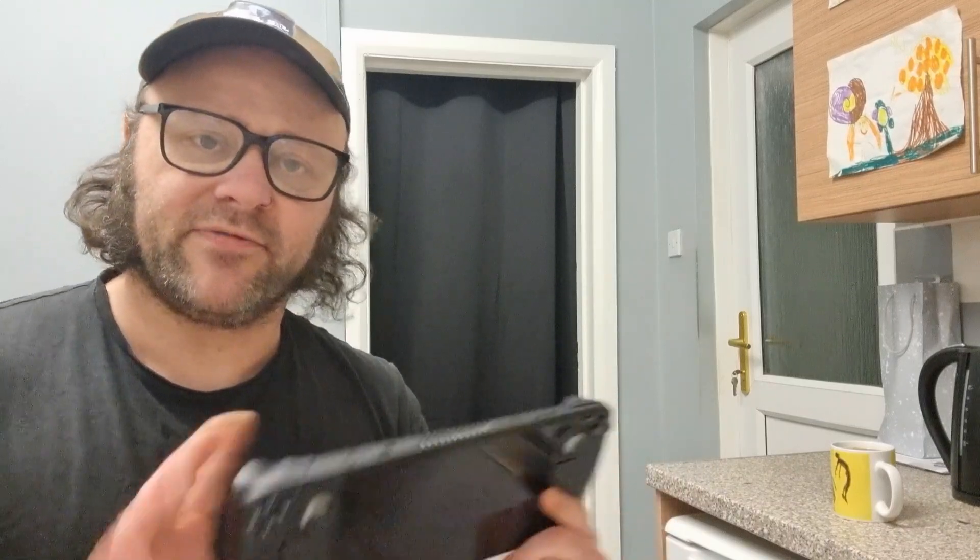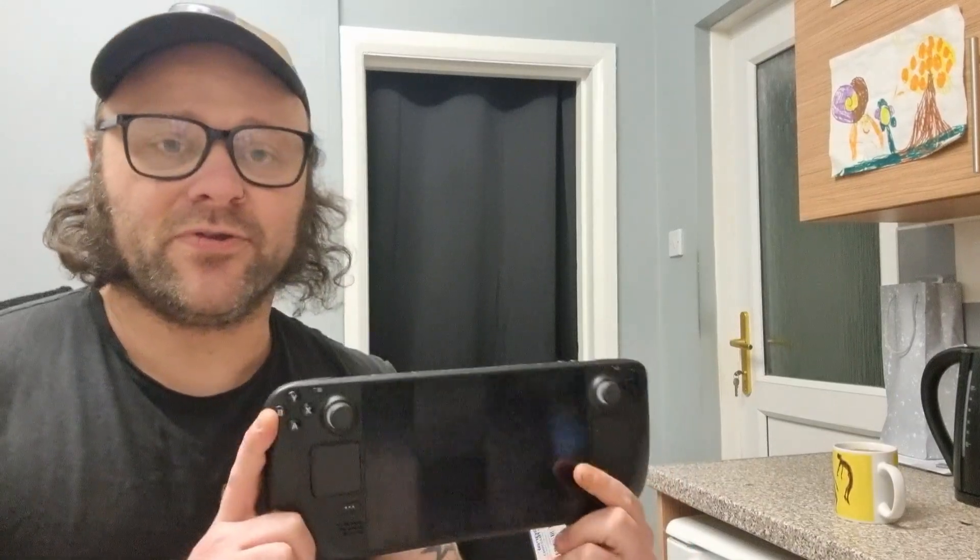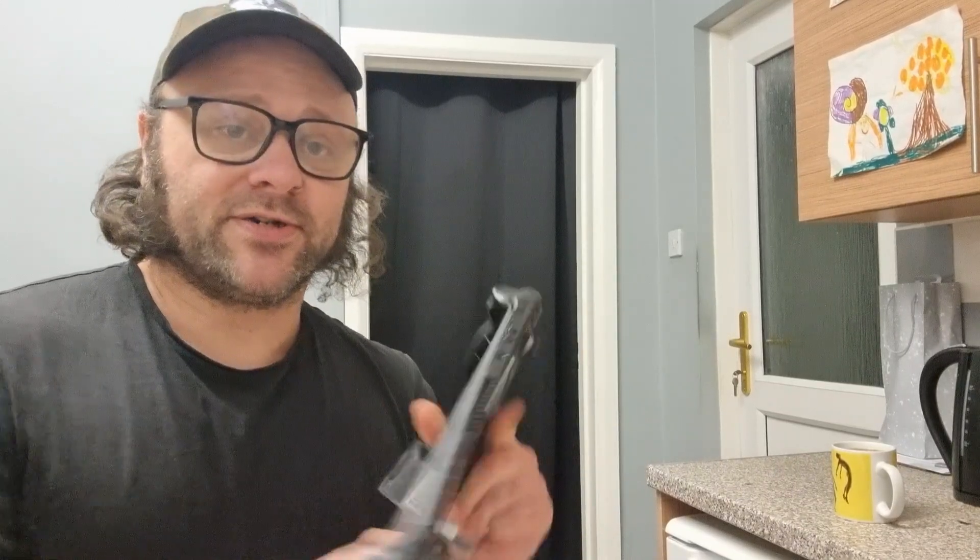Today I'm going to be showing you how to change or upgrade your Steam Deck SSD M.2 drive. I'm going to be taking out a 64 gigabyte SSD and replacing it with a brand new Integral one terabyte. Just like most people, if you can only get hold of a 64 gigabyte — the cheapest option — there's no space, hence why people want to upgrade. In this guide I'll show you how to open it correctly, install the new M.2 SSD, and reinstall SteamOS.